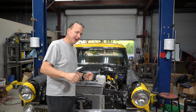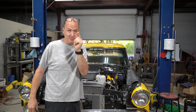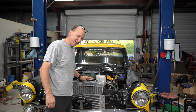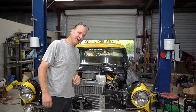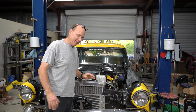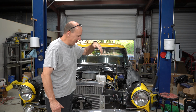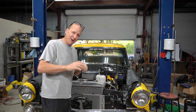The coolant is in. Now, I did move the radiator forward just a little bit more from where it was. I went to a cap without the little red release handle because I have a hood to radiator cap clearance issue, so I'm hoping that changing that cap I'm still okay, even though I moved it a little bit more forward because the front of the hood rolls. We'll find out. I'll put some Play-Doh on there and close the hood down carefully.